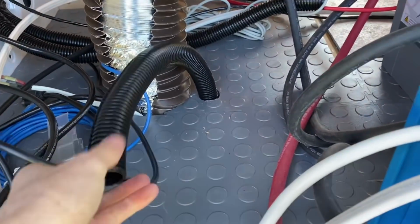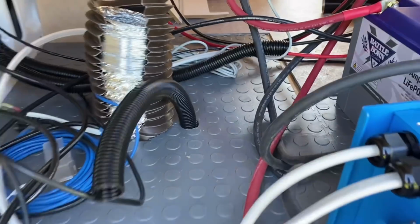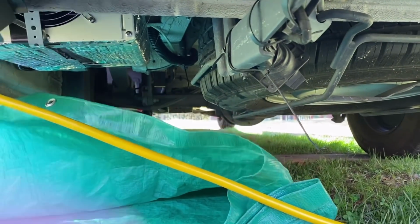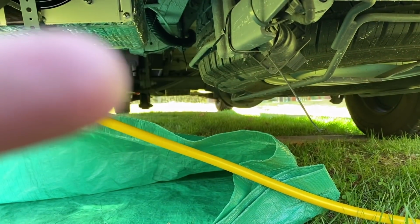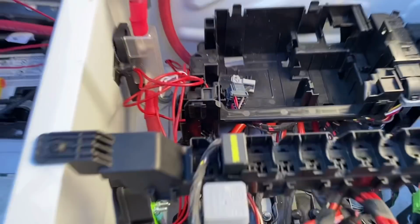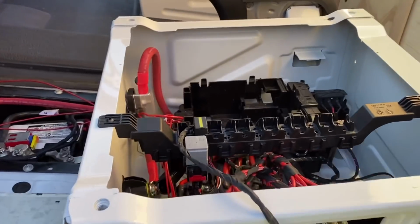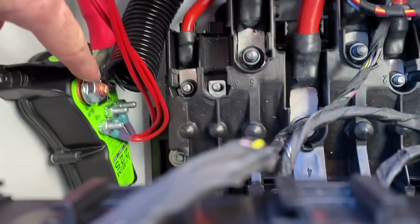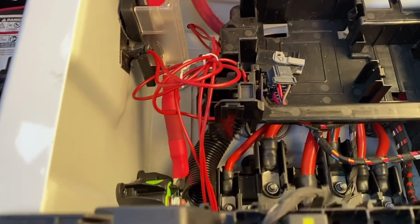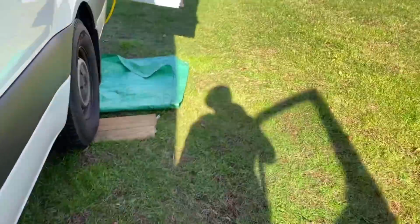I have my conduit run. It's coming in right here, and it goes down under the van, comes out right next to that AC there. You can see it. Let's see, right there. And goes all the way down and comes in right here in the driver's seat. So the 2-aught is gonna get run right into here and hook right up to battery coach and go into our Lynx distributor. And the one other thing to do up here now is to run, let's go down here.